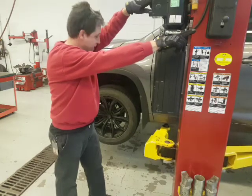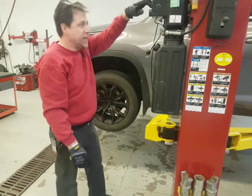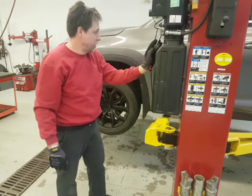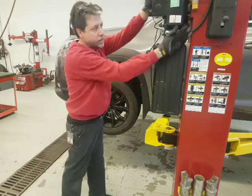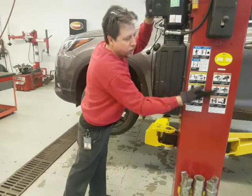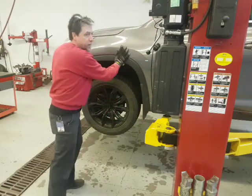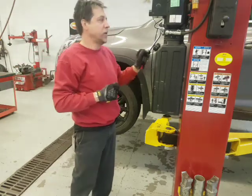Hear it, you can see it, those are the safeties. Anytime I let the vehicle down now, it will catch a safety. There it is. There's no hydraulic pressure here on the system. It's actually resting on welded plates, so nothing's going to bring this vehicle down. And it is very secure. Okay, we can actually do engine suspension work and the car will be very secure.